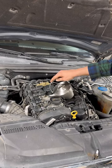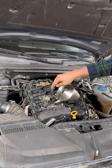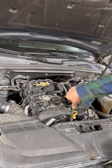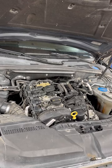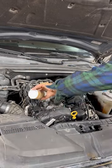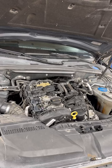I'm doing a carbon cleaning with a twist — I'm only trying to see the results on cylinders one and two. I'm talking like 10 different series of flushes. Sometimes I'm letting it sit, sometimes blowing it out with compressed air, sometimes rotating the engine over by hand a few times and letting it sit, sometimes cranking it over with the starter motor.